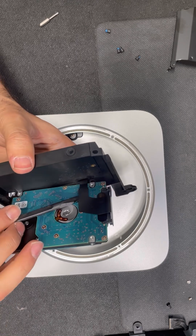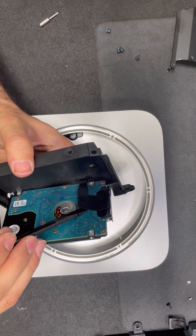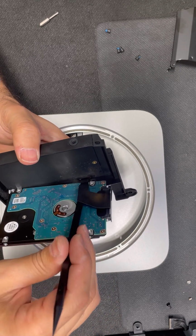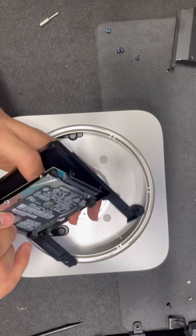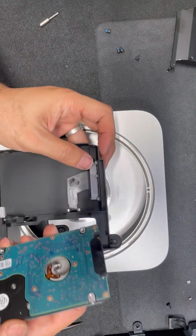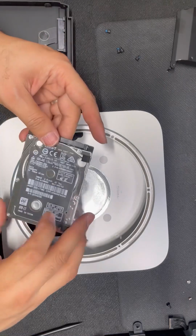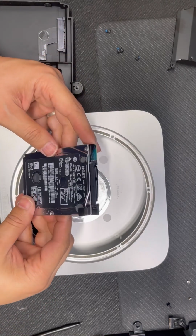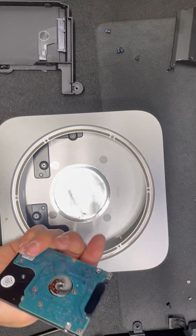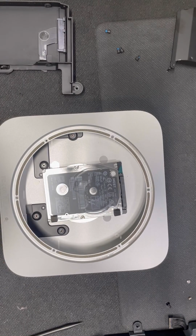There's a hard drive cable. It's a little glued to the back of the hard drive, so we have to carefully release it. And then we can unplug the hard drive. This is the hard drive. So this could be just upgraded with another 2.5 hard drive or SSD hard drive. Thank you for watching.